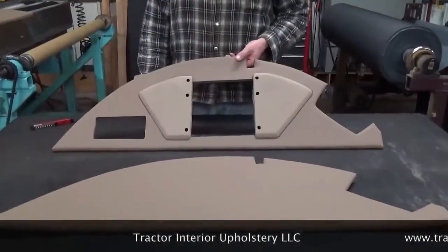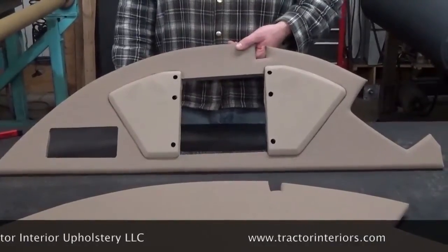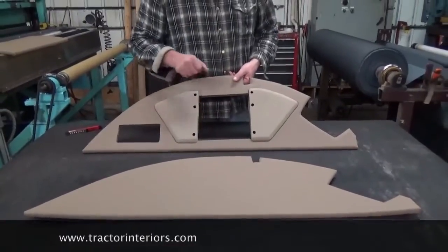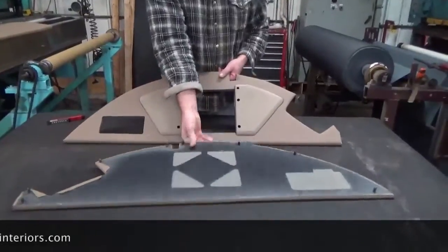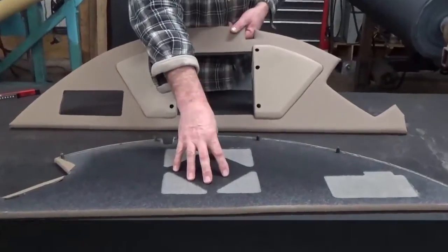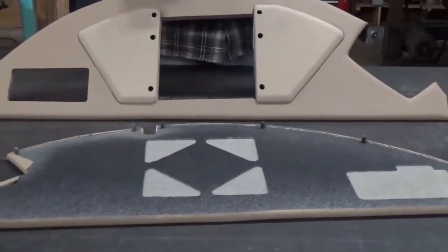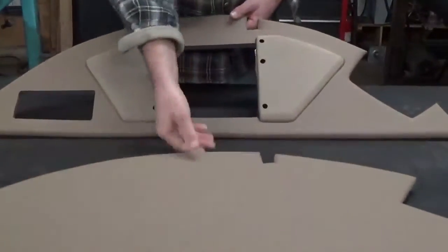This is a 55 series front headliner. You have two options on the front headliner for the 55s. It can either be one such as this without the speakers. The one without the speaker is still available for a radio — if you cut this part out right here, you take that out and put your radio in, cutting right around this area. Your dome light goes there, and that's the same dome light as this part over here — similar part, same part.